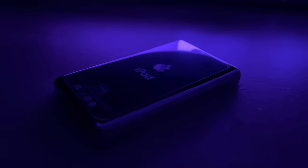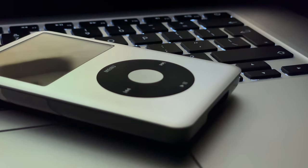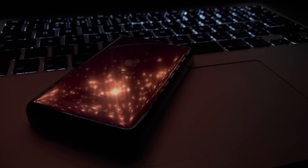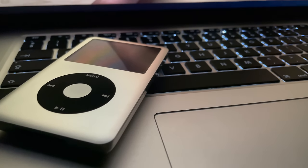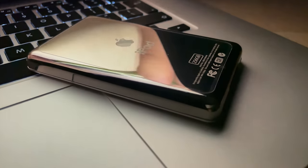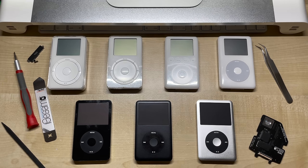Well, that certainly was different. What started off as the Taptic Engine mod ended as a complete rebuild and restoration of this old and broken 7th generation iPod classic. The front plate is now silver paired with a matte black click wheel, which matches the look of a unibody MacBook with its keyboard. The back has also been replaced with a custom part displaying the correct 256GB capacity. On top of that, we also have faster flash storage, a bigger battery, and most importantly, a Taptic Engine. And because of the all-metal design, the haptic feedback is super clean and satisfying to use. I would just like to thank everyone in the iPod modding and iPod Haven Discord servers for their time and feedback when making this video. I hope you've enjoyed watching this as much as I've enjoyed making it. Thanks for watching, and I'll see you next time.